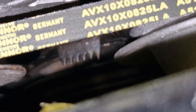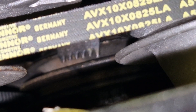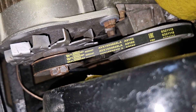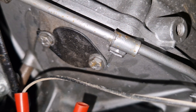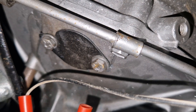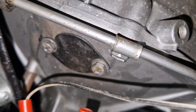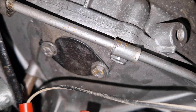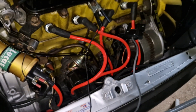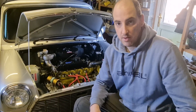The longest tooth is zero, and each tooth going down towards the bottom of the car is an additional four degrees. There are some cars that don't have this setup — if you don't have that arrangement, it's possible that if you've got an inspection plate here you can open it up on the end of the clutch housing, and there are marks inside there as well. This is covered in the Haynes manual. So now you can set your basic 10 to 12 degrees timing.